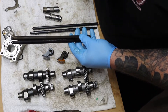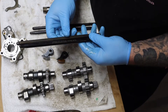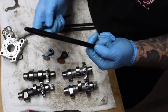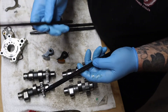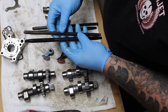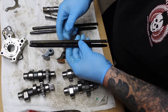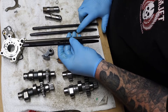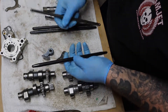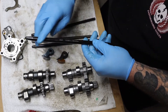New push rods — this was a recommendation from the people at Fueling, because the high lift on these cams may cause the stock push rods to flex. And these big ones will not. These things are heavy — twice the weight of the stock one. You can just look at them and tell the difference, not just in the tapering at the ends but even the thickness. These are .165 thick wall — 10.4 inch for the intake and 10.525 for the exhaust. So they are stock length, one piece. And they say 'Fueling — exhaust' on them so you don't get them mixed up, because they are different lengths.